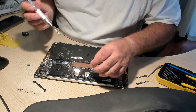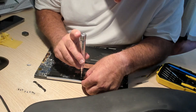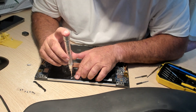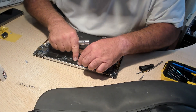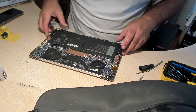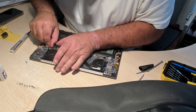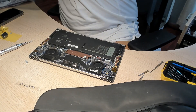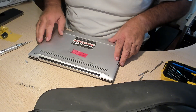The reverse process is very simple — just reverse everything you've done. Put the screws back on the hinges. Put the first bridge back on which holds the connectors onto the screen. Put the top bridge on top and make sure it's nicely screwed on. Then all you have to do is clip the battery back in place. Once you've done that, clip the aluminium back onto the laptop.